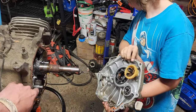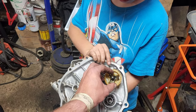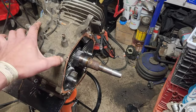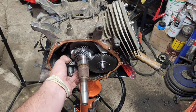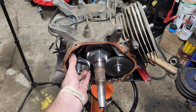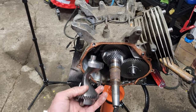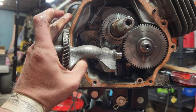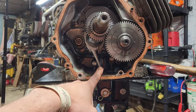Pull it straight off. This is your primary bearing. This is your governor gear — which if you're doing a governor delete, this is the thing that you obliterate and take out along with the other end of this bar, which we will be doing for building this into a mud mower. We're going to see our balance shaft — everybody gets in a controversy as to whether this is something you leave in here or not. If you choose to take the balance shaft out, you want to make sure you take the bearings that coincide with it also out of the entire system. There's the balance shaft — that bearing in there, you want to pull if you're going to take your balance shaft out. It can walk itself out and end up in everything else. This is your oil sensor, and this is your cam.